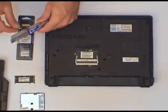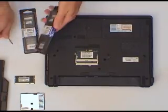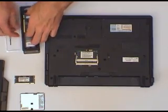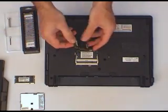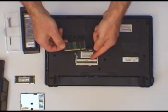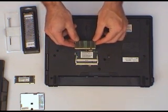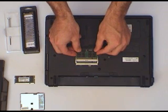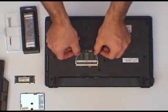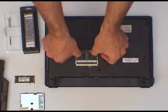Now open up our brand new Kingston upgrades and we'll install them. So upgrade number one — we need to line up this slot here, which is keyed to match the key in the memory slot, so they can only go in one way. We're going to put the bottom one in first. Slide it in at an angle of about 45 degrees until it's firmly in. Make sure you've got it firmly in at either end, and then just push down.